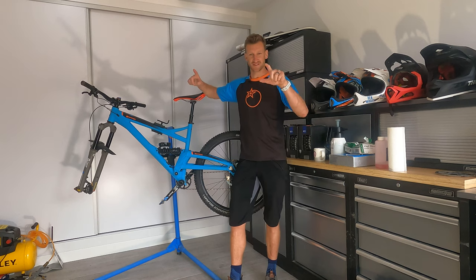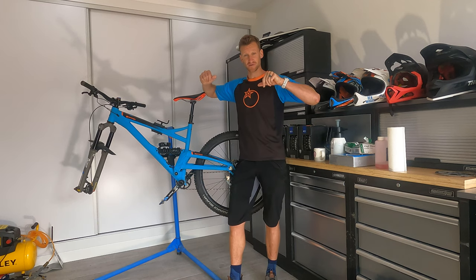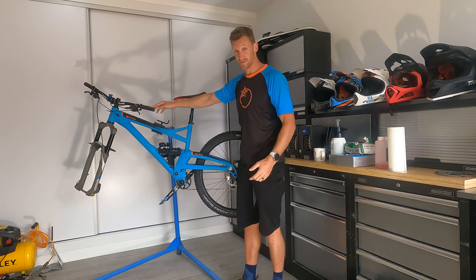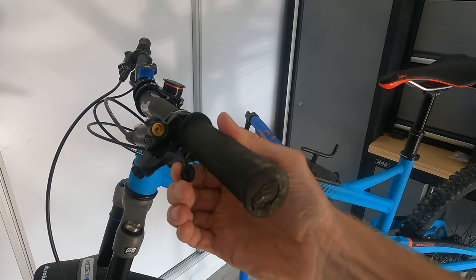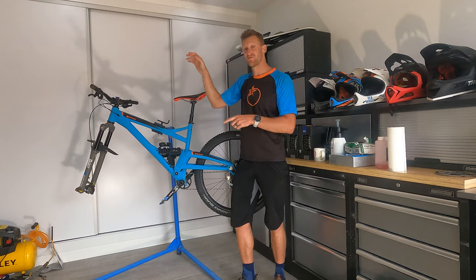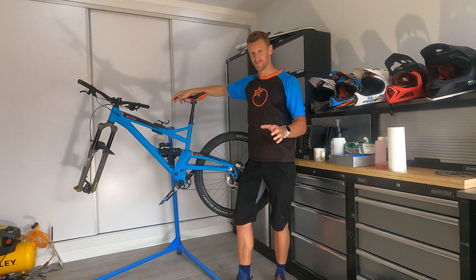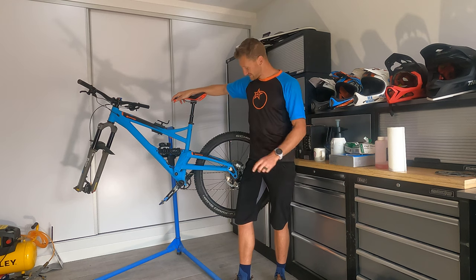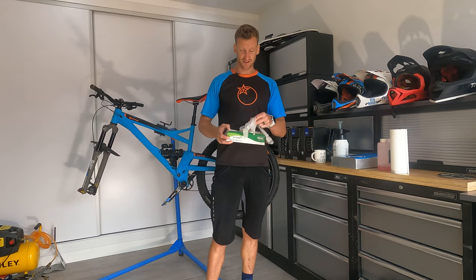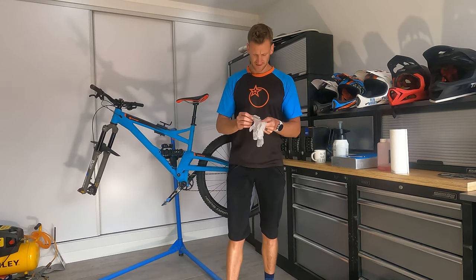If you're like me you won't want those brake levers to come flying all the way into the bars when you pull the brakes. My personal preference on brakes is limited movement on the lever, maximum power. On my Switch Six, pulling the lever it's coming nearly to the bars, so that tells me this is ready for a bleed. We're gonna bleed it through and then do my secret little maneuver to make sure those levers only go limited movement — a couple of mil. Let's get to work.